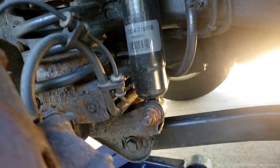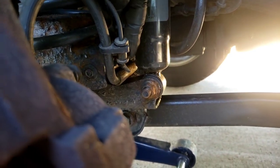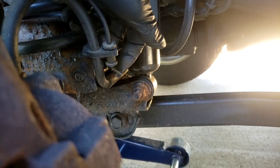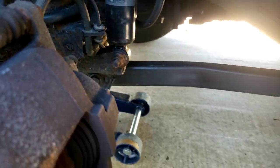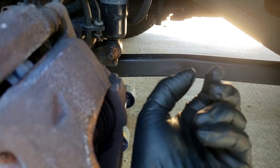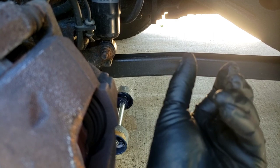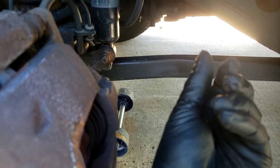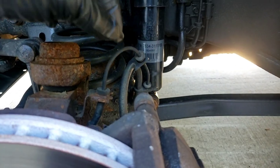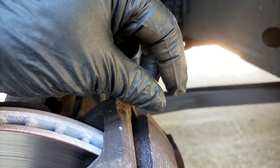The problem is this brake hose. See that bracket right here? It holds a lot of sediment and rust in there. That bracket is already surrounding the hose just to hold it there, but as the rust accumulates inside, it starts to squeeze the hose — almost like pinching the straw on your drink. So this hose will get pinched over time and get smaller and smaller.